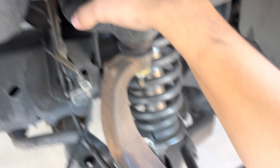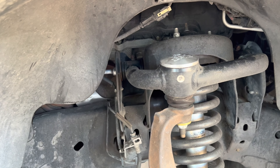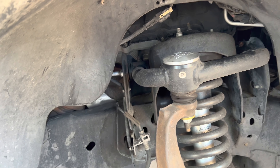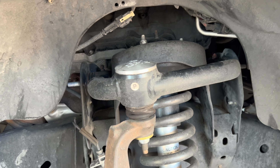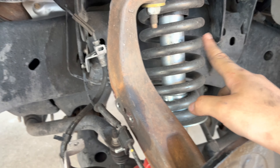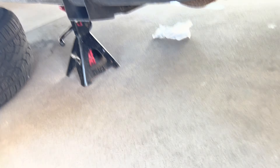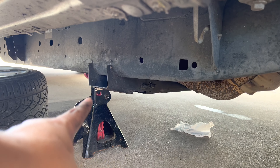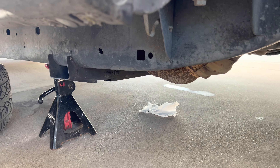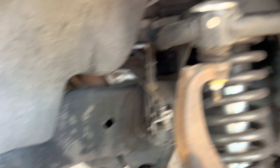We're also going to need to readjust these upper control arms. I asked around and was told about half an inch to three-quarters of an inch. That's what La Colorada, or CTP, told me — to adjust them to that since I'm gonna be going to five or five-and-a-half inches. We still have the transmission cross member sitting pretty low, and I already scraped a lot at a four-inch drop, so I think I'll set it at five for now.